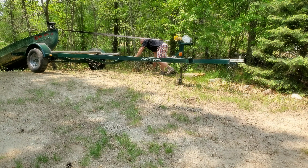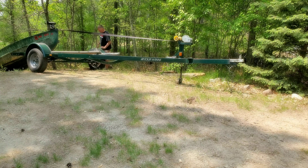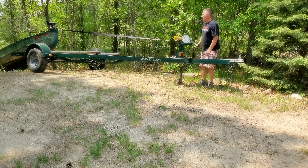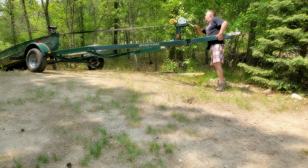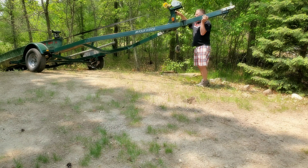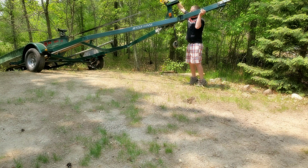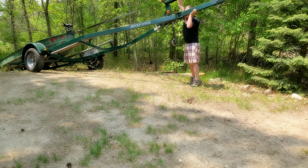Another thing you want to do is chock your wheels so your trailer doesn't roll back any further, especially if you're on a hill. Don't chock the wheels at the beginning because it won't load the boat right away — that's just more of a safety measure in case it goes backwards. Now, as the pressure gets on there, this gets lighter. I think it's best if you get as much of the boat on as you can without putting this down. Now it's like a flat load right out of the lake — it gets so easy I have to almost let go.